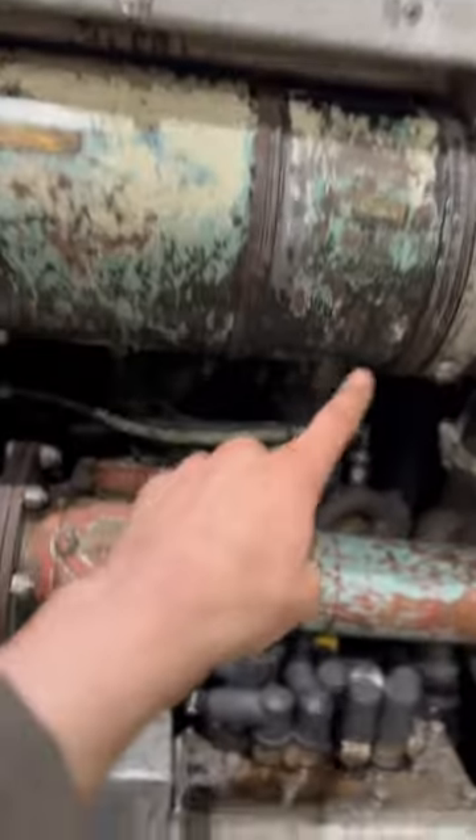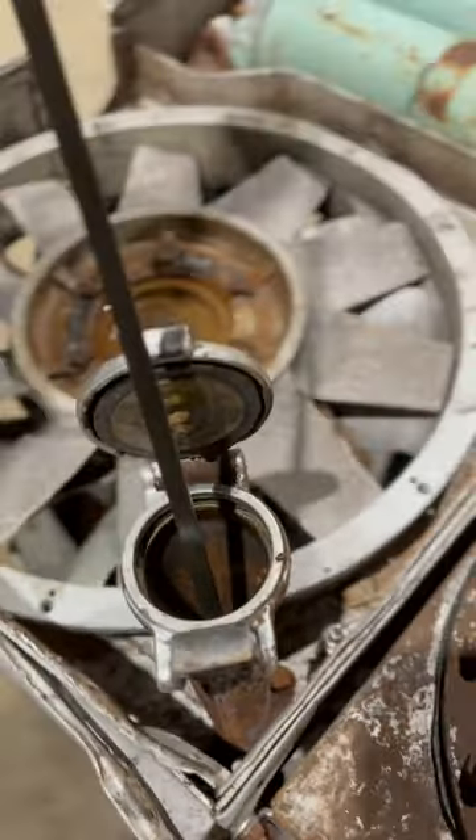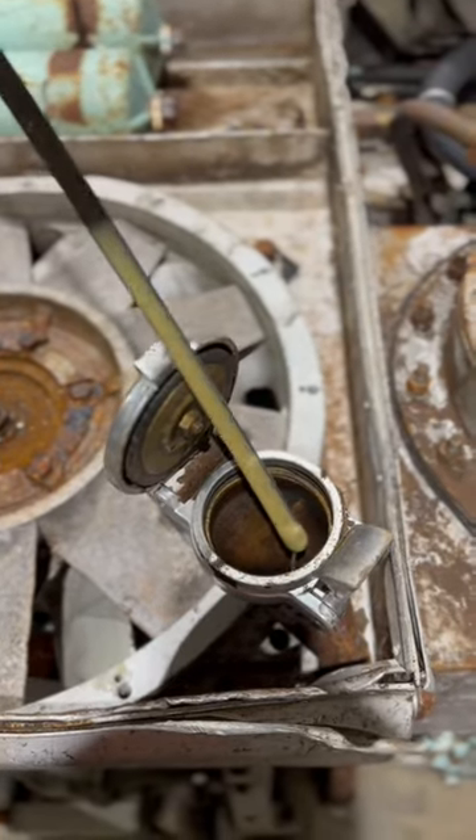After washing the engine, I actually noticed that the oil tank started leaking, so that's now going to have to come off. The heat exchanger's got to come off as well because that's putting water out of the engine into the gearbox and making that milky. I will be putting a full video on this shortly. Well, that wasn't very enjoyable. Still more to go.